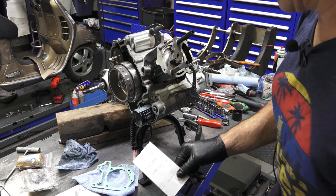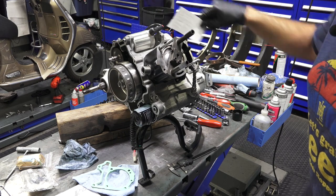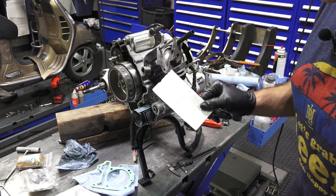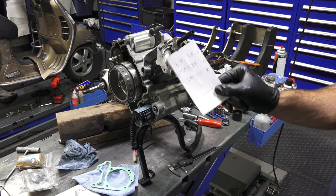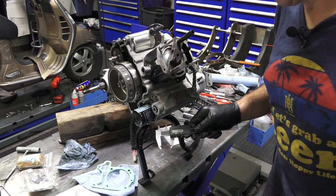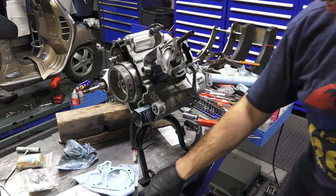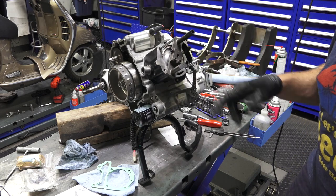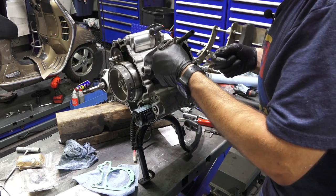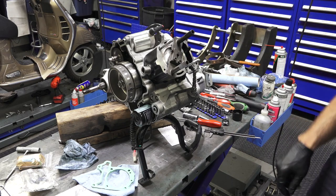So we can use the thinnest gasket on this engine. A combination of the crankshaft, the piston, the cylinder, and the machining of the crankcase deck all determines the thickness of the gasket. 3.72, 3.73. Essentially, when I have this tool on the flat table's top, I zeroed it out, and I'm measuring the distance pretty much between the flat of the surface and the very tip of the crown.